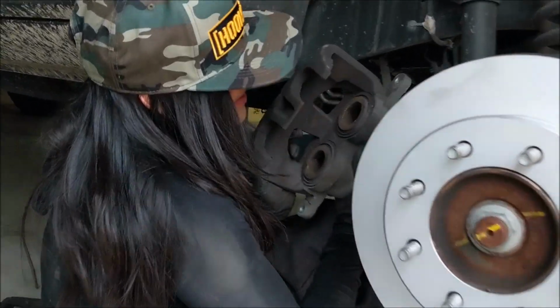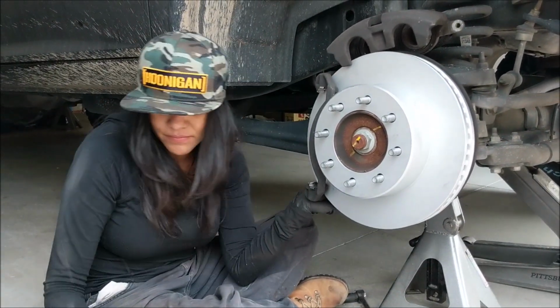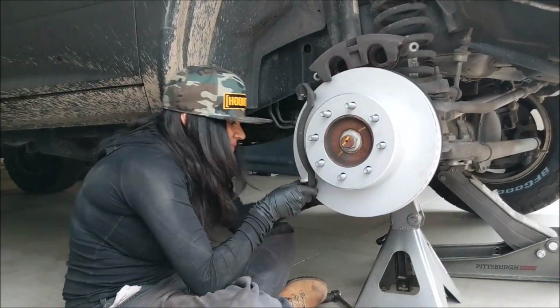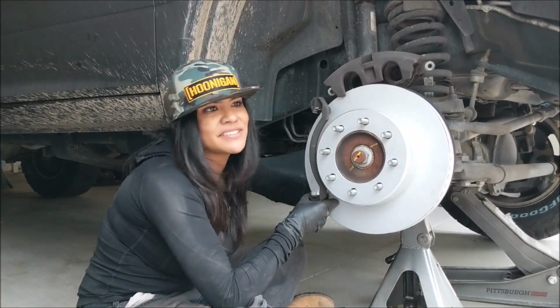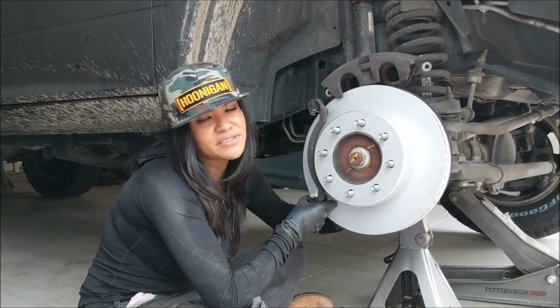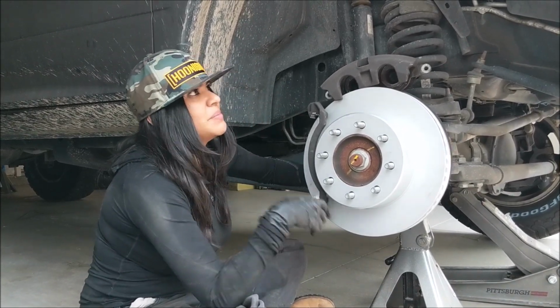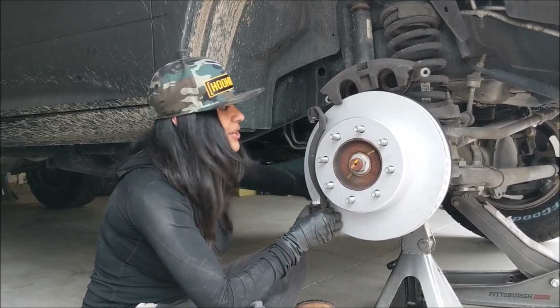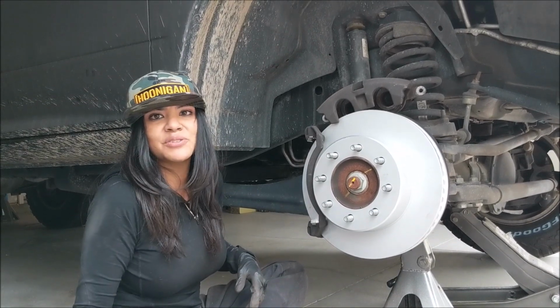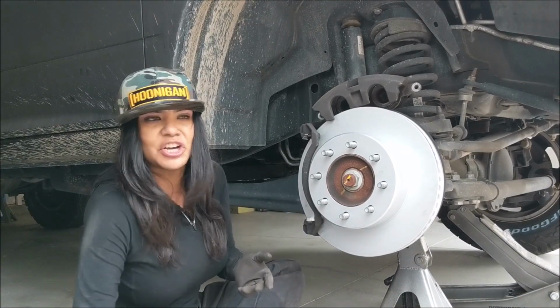Okay, finally. Slay it. Wham, wham, wham. Oh my god. So are these brake pads synthetic or poly-formed? These brake pads are semi-metallic. What does that mean? How does that translate to good braking? It depends on the type of material, and depending on how they compound it, each handles different temperature ranges. Especially when you're racing, or in a big beastie like this, you want something that can handle high temperature ranges so you don't get brake fade and smoosh into a little car that cuts you off, when you're towing a 45-foot rig and they think you're gonna magically stop on a dime.